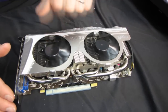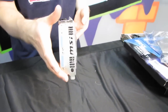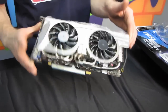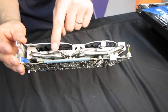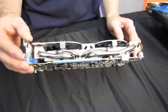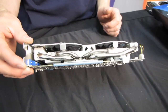We've got a couple of 92mm low-profile fans, which allows MSI to maintain a two-slot profile while putting in a dual-fan custom cooler solution. We've got two super pipes — here are your two regular heat pipes in the middle of the GPU, and the two super pipes go out further away because they need to carry heat more efficiently over a greater distance.